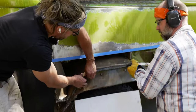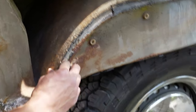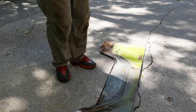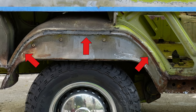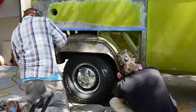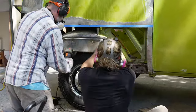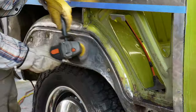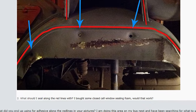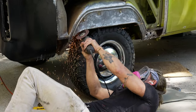All this is the original foam. We're going to replace it with seam sealer because it's the best we've got, and we're going to get all this cleaned up. From factory, along this channel Volkswagen used some kind of adhesive foam to adhere that quarter panel to the inside of the wheel well. This prevents oil canning and also makes that area a lot sturdier so you don't get weird waves in the sheet metal. We'll be doing that with seam sealer as it seemed to be the best solution after looking for it on the Samba for a long time. Hopefully I'm helping you guys find some solutions to what might be a problem you're having.